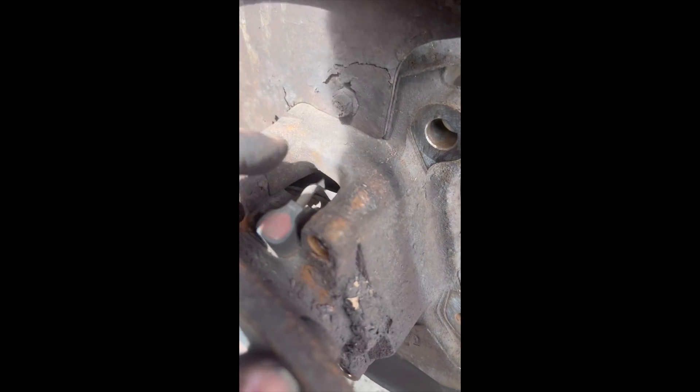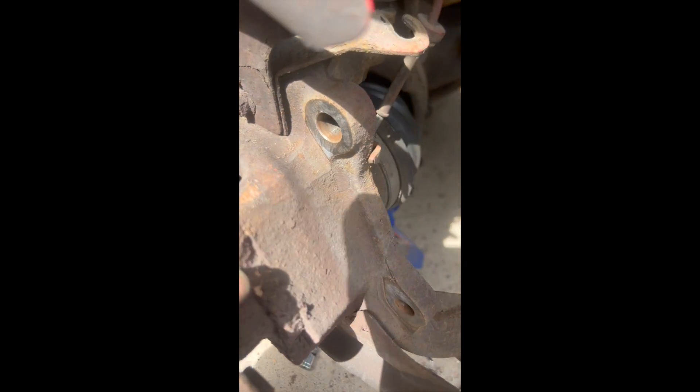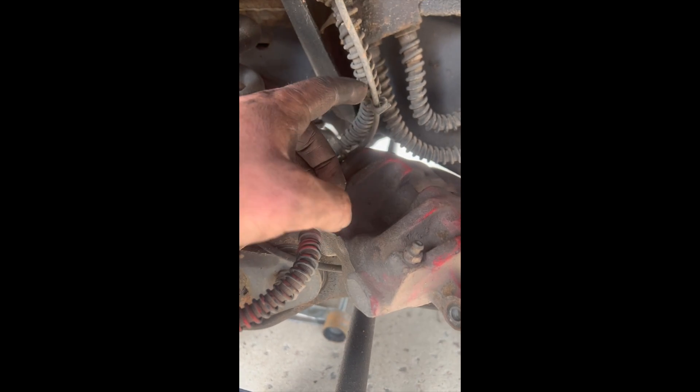Something I should tell you — here's your ABS sensor for the hub. The wire runs back here, and there's a bracket for your top 15mm bolt for the hub. That's one of the places where the ABS sensor is mounted. I usually just keep this bolt hanging around here and then take this out. Sometimes the hubs I get come with the ABS sensor, so I'll show you how I flow it through here and get it up to where this grommet is, and then the grommet goes up to where it plugs in. It kind of mounts here, then comes over and mounts on this bracket, and threads through these little clips — you just pull the clips back and take that wire out.